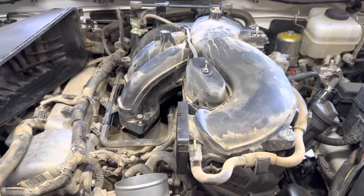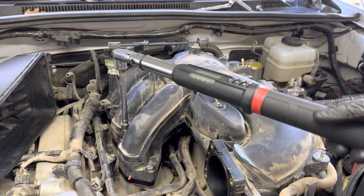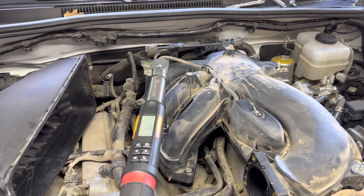In the place of the stud it's a standard bolt, just like the rest of them. Do the same for the back and continue moving forward. Next is torquing the manifold — it's 21 foot-pounds and you do a cross pattern.